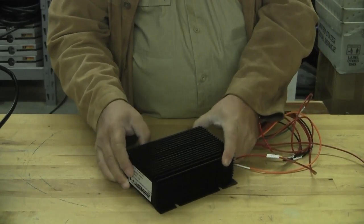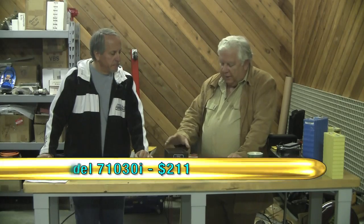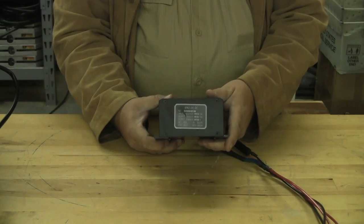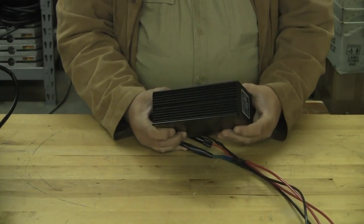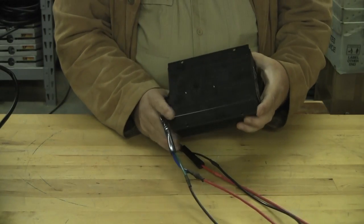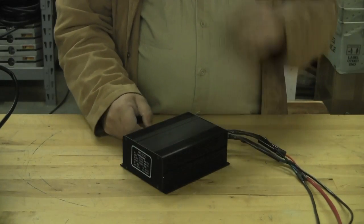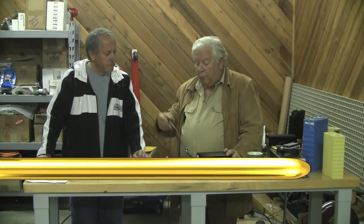This is the SurePower at $211, and it's good stuff — a great little thing. This one is our Chinese version of the same thing. I would love to report that it being Chinese makes it a cheap piece of crap you want to avoid. Unfortunately, this baby's a monster. It also has a sealed case, finned aluminum heat sink, much simpler design. You've got two wires in with an inline fuse holder, which I like, for your traction pack, and two wires out — one for ground, one for 12 volts.